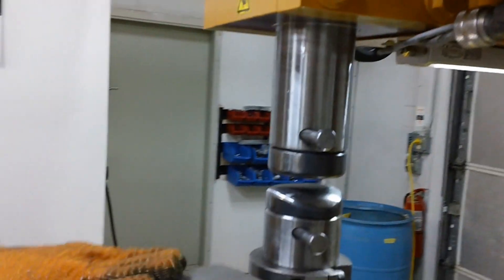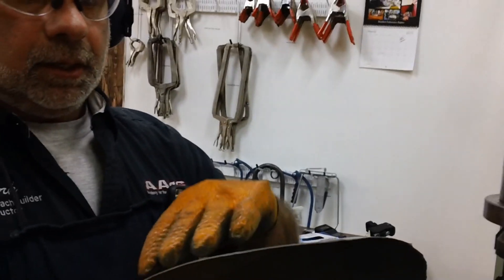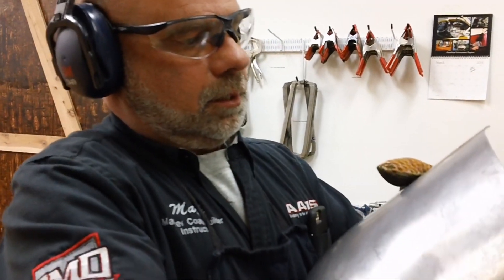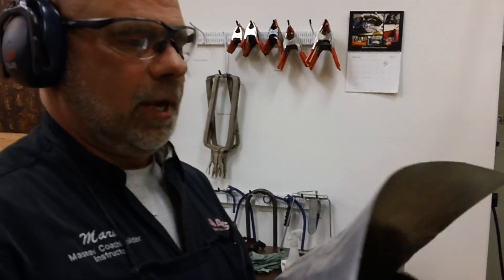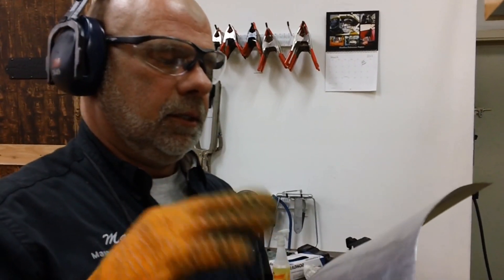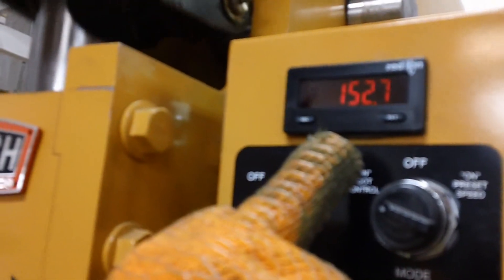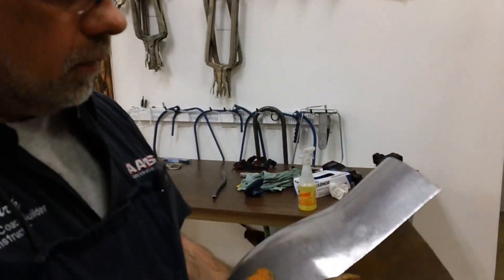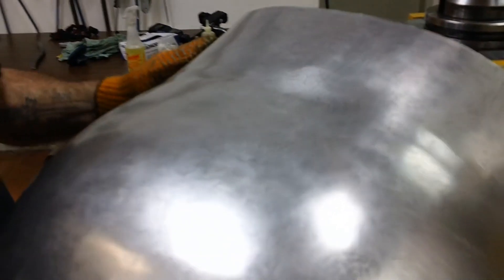Control of your metal is by applying the correct amount of hit, pressure, and orientation of the panel in the tools — it gives you everything that you need in order to make your panel fit. But you have to be able to visualize your panel in your mind while you're making it. Up here on this machine we also have an RPM meter, so if you have a certain sweet spot that works better you can dial the machine in to run right at that point.